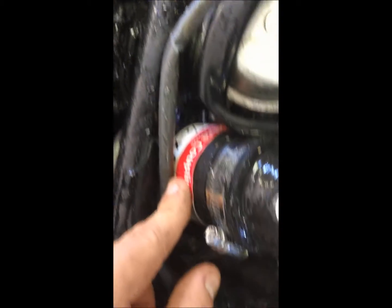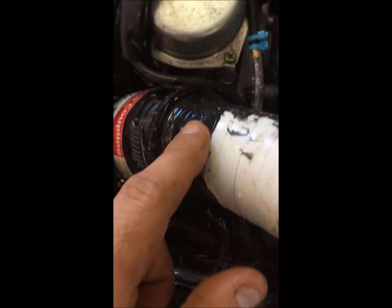I used a one-and-a-half-inch coupling here — there's a lot of black silicone. The pipe runs underneath the bike and I routed it in between the frame to prevent shock rubbing. As you can see, the shock is right here, and if I hadn't done that the pipe would have come out near the shock and curled around it, which would have probably caused problems later on.